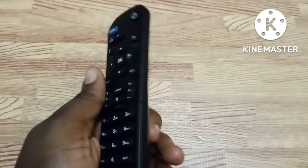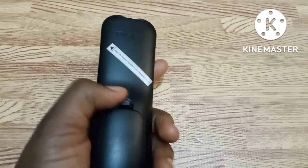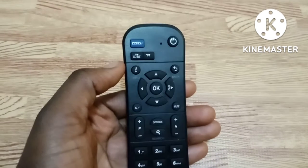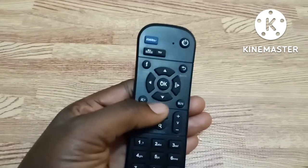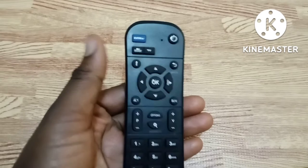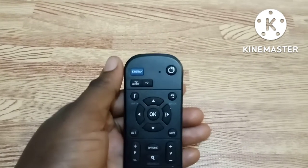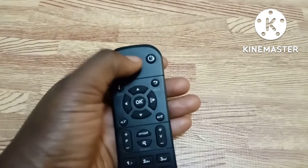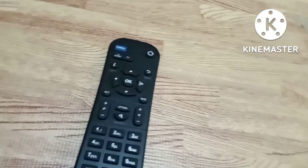Before that, please make sure your battery is in good shape. This is a new battery and I know it's in good shape. After I checked the battery and confirmed it's okay, the next thing is to press and hold the Info and Back button for about five to six seconds until you see the light blink. That means you have automatically changed the mode of the remote — release and your remote starts to work.